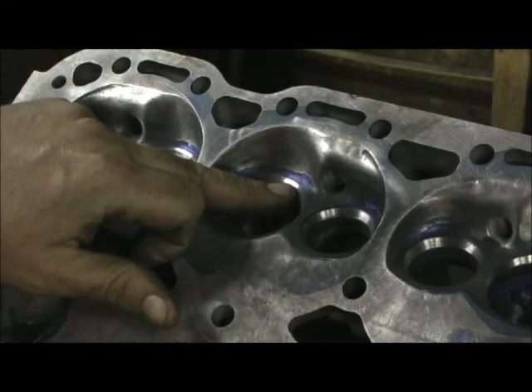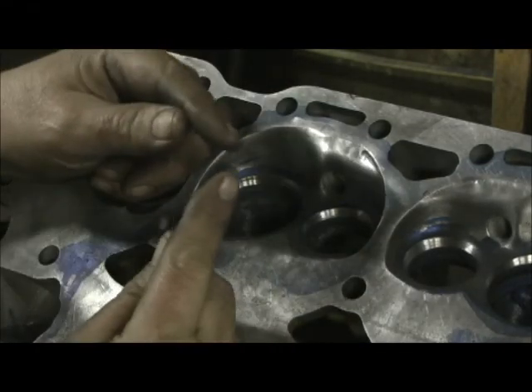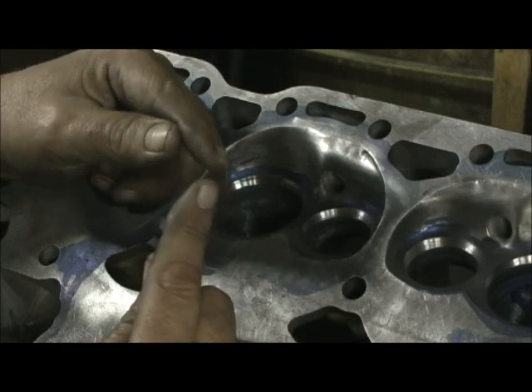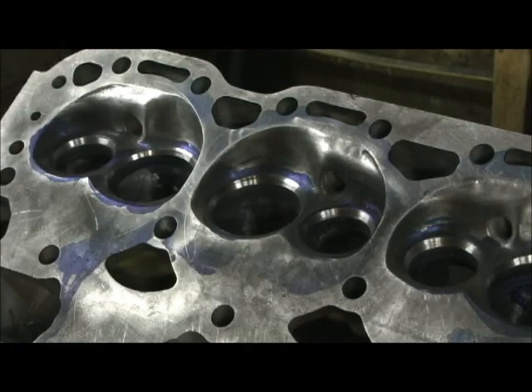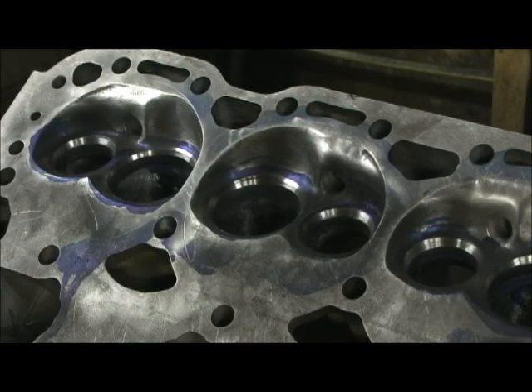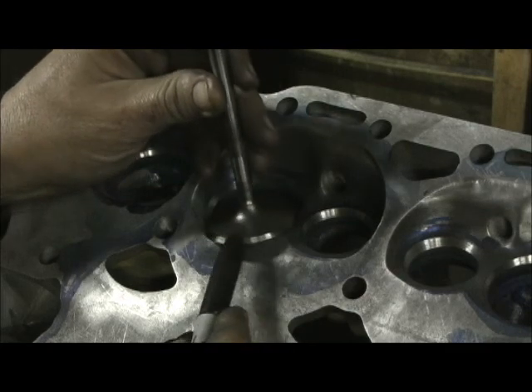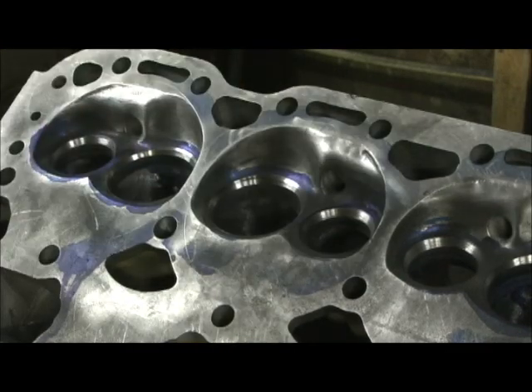Where do you put the position at? Well, as the 60 and a 30 come to a point they touch each other and it forms a ring. What I've done for years is I take a Sharpie and I mark it in three spots on the valve, kind of like a triangle, and you go in here and put the valve in.